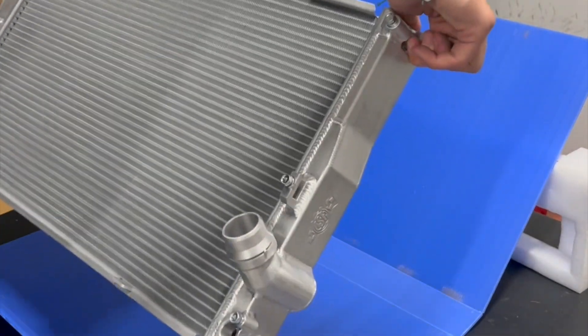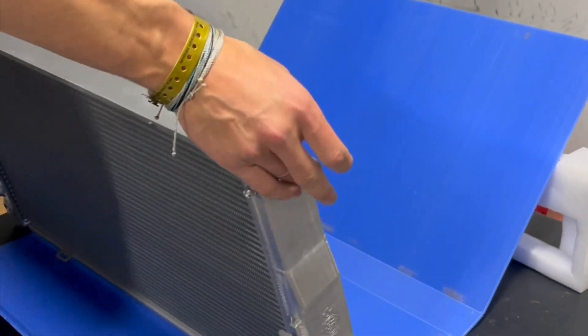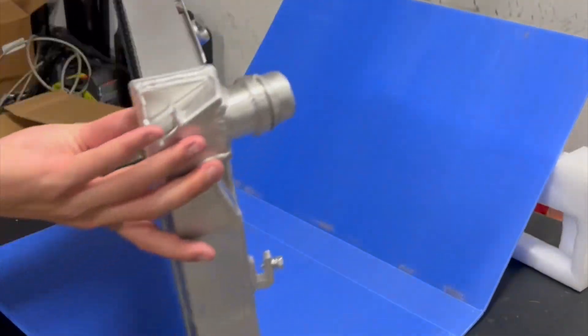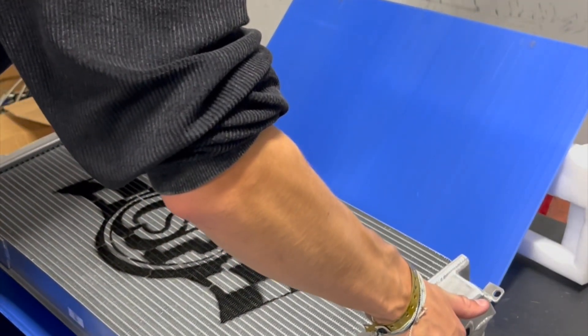There is a shadow limp mode leading up to that — at around 240 degrees your car will start limiting power. Shifts will also be kind of strange, and it's just not good to have coolant that hot while on the track as you're slowly cooking your engine.